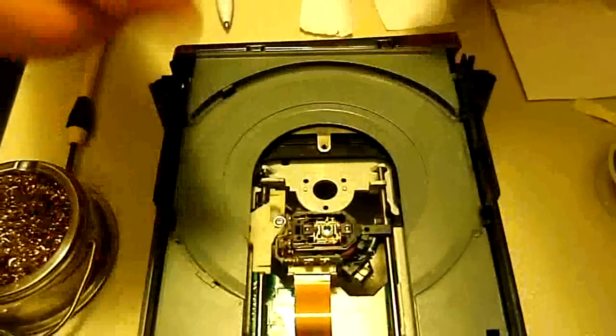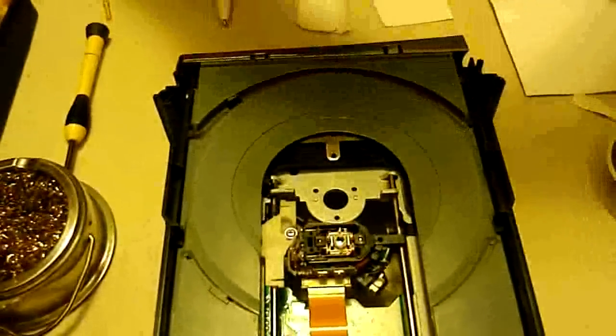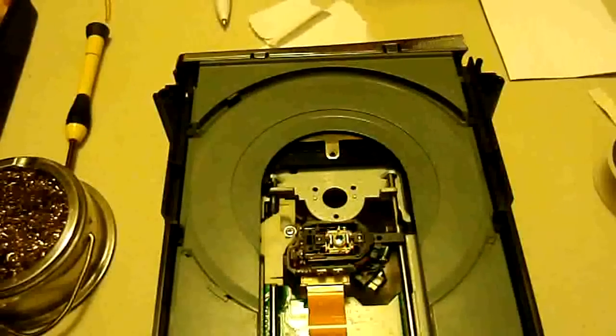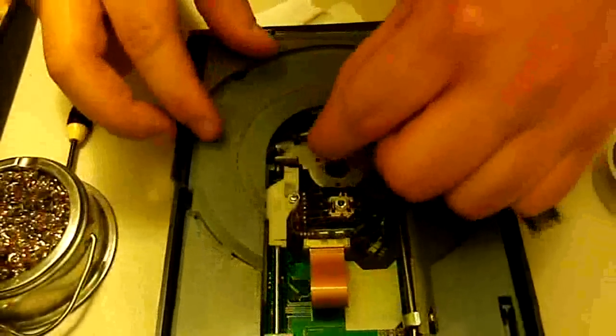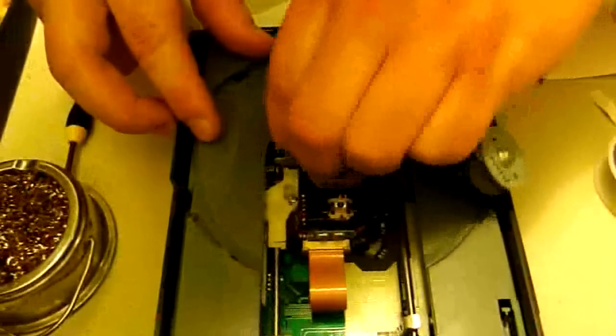And if you look, there is a little slot where those wires go back, so keep that in mind when you're putting this back together. Alright, so we'll get our replacement here. Oh, I don't want to drop it and break it. What we'll do first with this replacement is work the wires through that little slot I was just showing you. And as you're doing that, start prying them around and get a hold of them once they come through. Just like that.